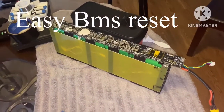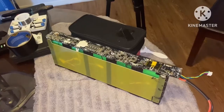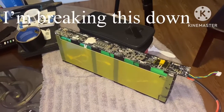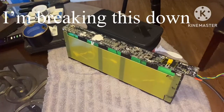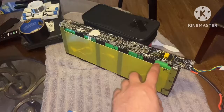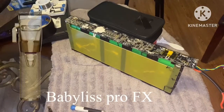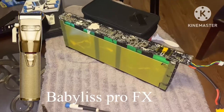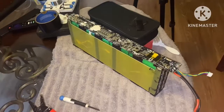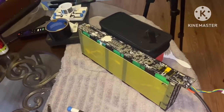This video is for anybody having a battery issue. If you have a red light, your battery's probably not charging. I have a solution for you. This battery pack did have a red light — I just got rid of it. I'm still going to take this apart because I need to get one of these green battery cells. I'm going to swap it out with one of the batteries already inside my hair clippers because those have a higher milliamp, which will allow a longer run time.